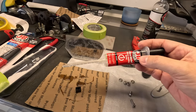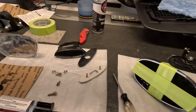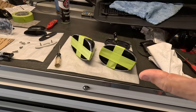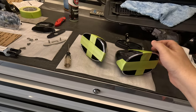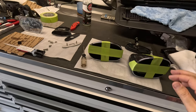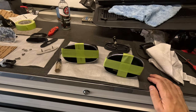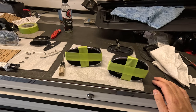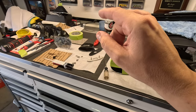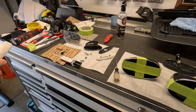It works really good. You basically break off the end and put this little tab on and it mixes it. We set that to the side and now we got both chrome bezels in place. We're using tape to apply the pressure to get a nice tight fit. I'm basically rotating these every 20-30 seconds just in case the epoxy is running - it's not super thick and I don't want it dripping out. We're going to let this set probably longer than five minutes to make sure it sets properly, and then we can move to the next step of assembly to get the mirrors bolted up.